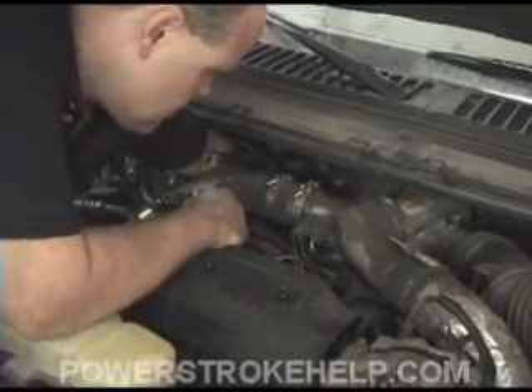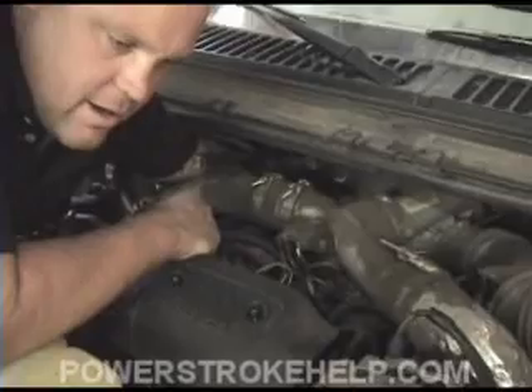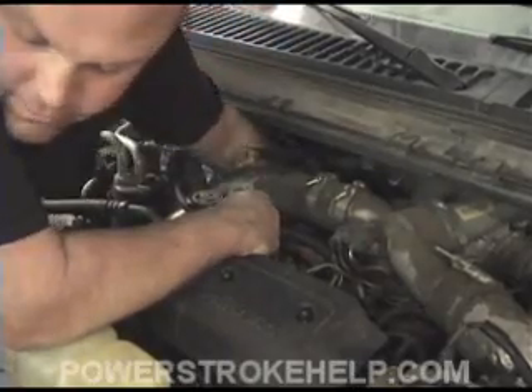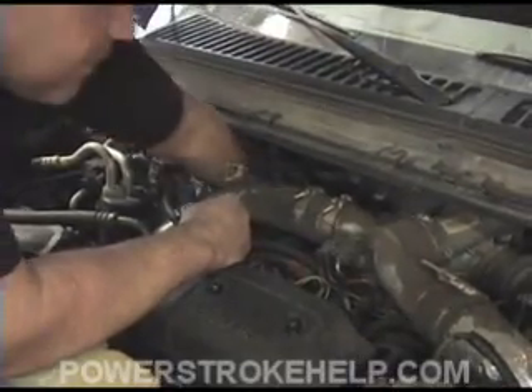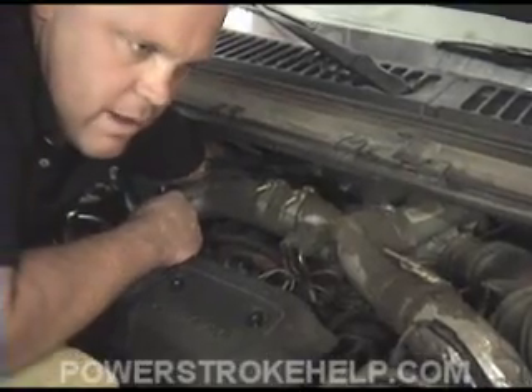Put a little air around here. It's just a matter of reaching back to get it and screwing it back in and tightening it down. You can put your fingers right on that thing on the very back there, and with your ratchet you kind of just have to fiddle around with it. Again, this swivel-head ratchet is invaluable in a situation like this because the firewall is kind of close back there.